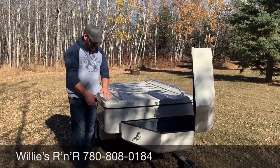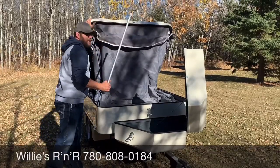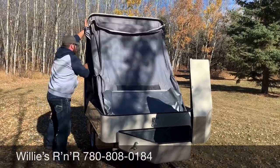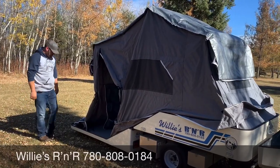So we're going to open that up and flip that over. Another tip: don't grab the rack and start pulling, and don't grab the corner and start pulling. What you want to do is grab the center of the lid, give it a little wiggle, and lift it up. Here's our magic stick — it'll come in handy when we're putting it back. Now we just walk this right over.